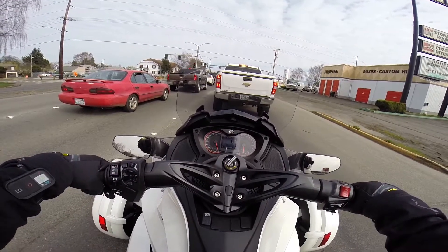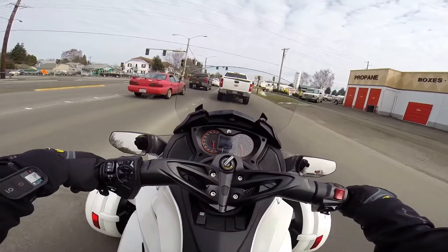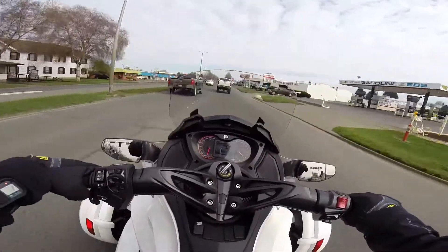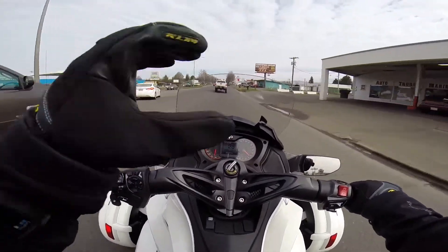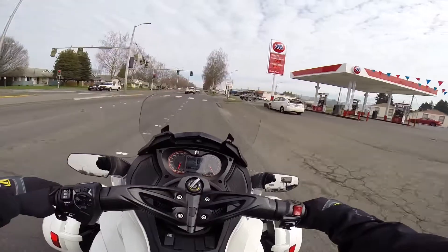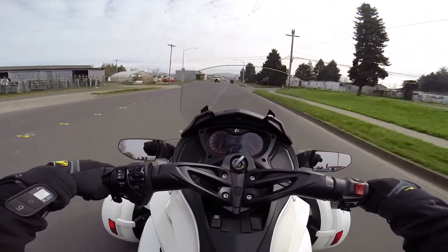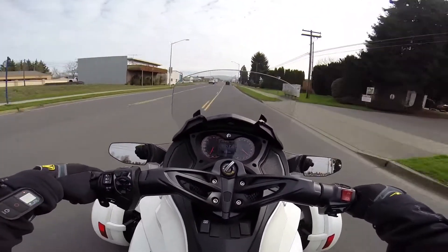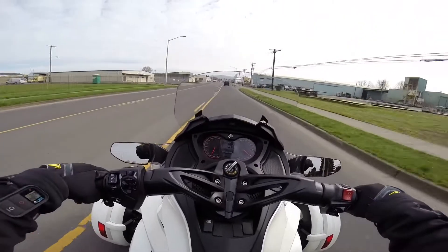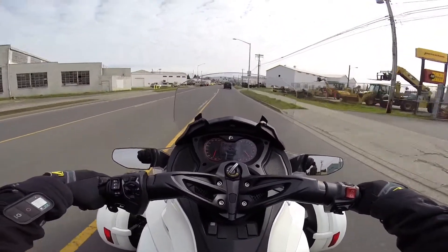I realized a weird thing that happened with this one on the right front wheel was the same as his. Essentially what it was is there was a buildup of clear coat. They paint and shave metal and do different things to the wheels and then they clear coat over them. The hole where the laser goes in through the wheel and magnetically attaches itself to the hub — it was snagging or dragging against that clear coat buildup. So I just reached in there and kind of shaved it down a little bit — it's just like a layer of plastic you're taking off. I didn't have to cut down to the metal; I didn't want to expose aluminum and have it start to oxidize 20 years down the road.